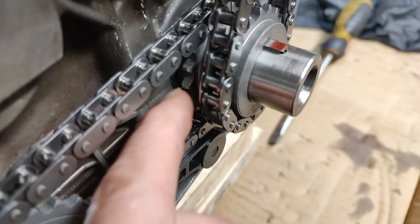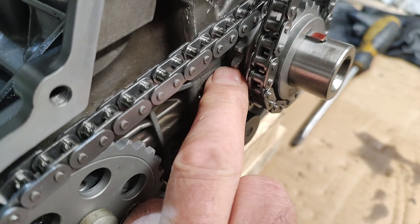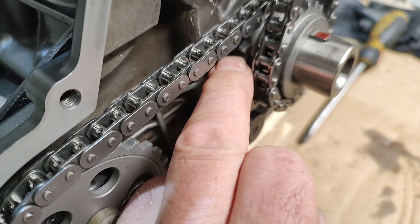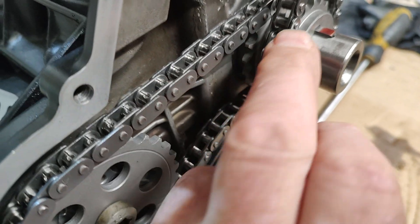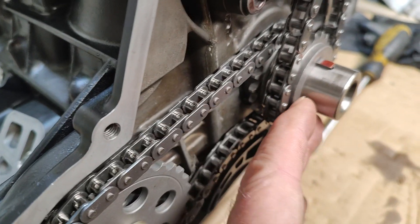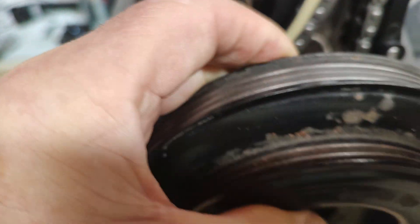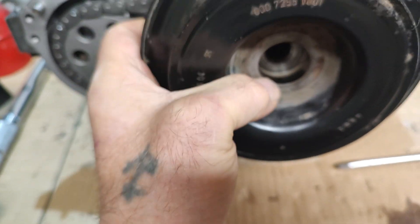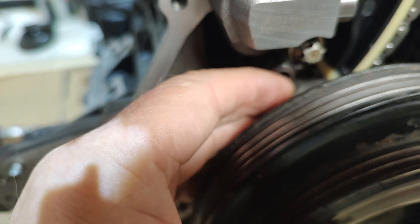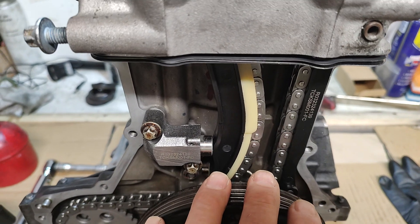What I did notice: the oil pump sprocket just slides on, it slides over that key and it free-spins on here. That sprocket is not locked onto the Woodruff key — it's only this sprocket and the pulley nut. I was a little puzzled as to why it would be free turning; I'd have thought they would have extended the Woodruff key to fit that sprocket too. But I worked out that once the pulley nut is pulled in, it pushes it all and tightens it with the pressure from the pulley nut.